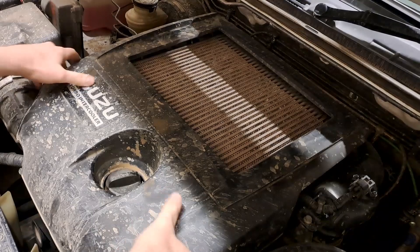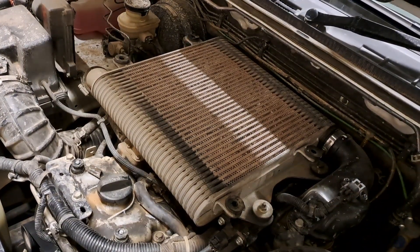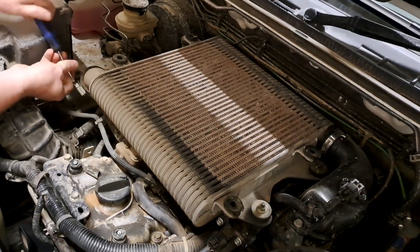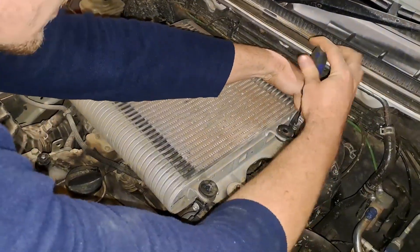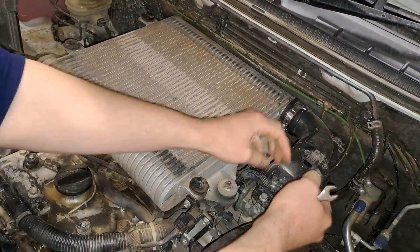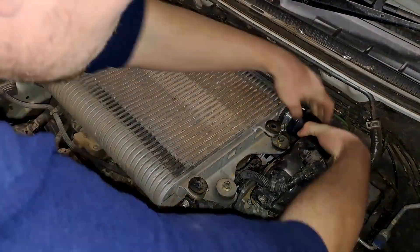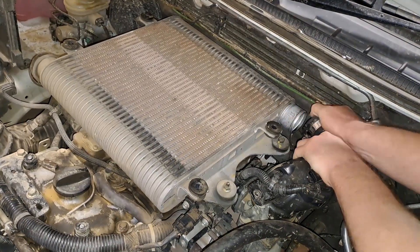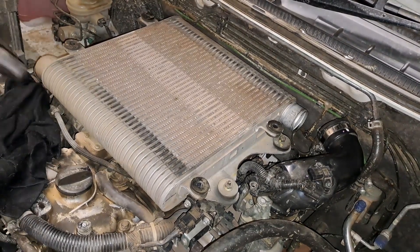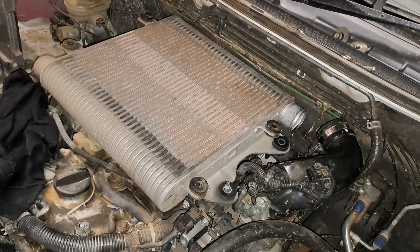First things first, take the cover off. Next thing we'll want to do is unbolt the intercooler that's sitting right on top so we can actually get to the hoses and everything where the injectors are sitting. I just opted to take this plastic hose off — all it took was a 10mm spanner and off it came. Obviously it's just your map sensor on top that you need to unclip. The intercooler itself just has a few 12mm bolts keeping it on there, so just go ahead and put some sockets on it.